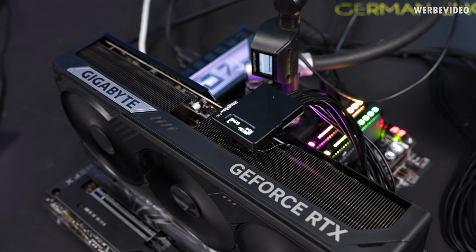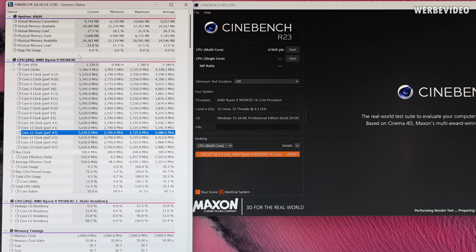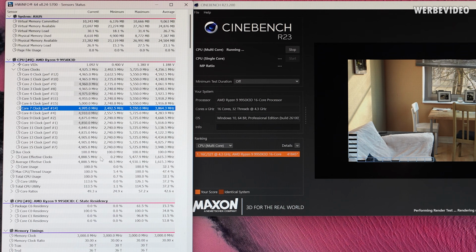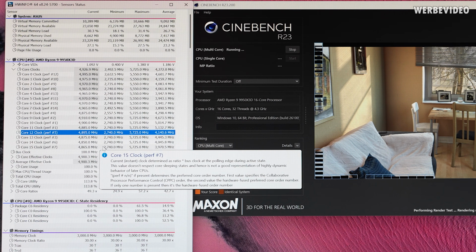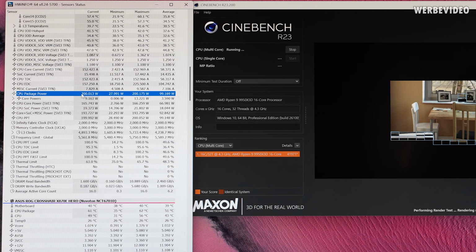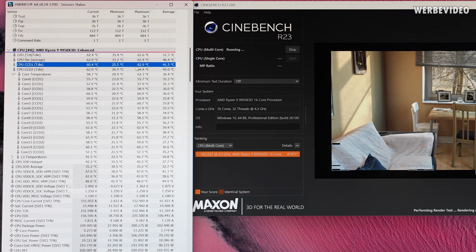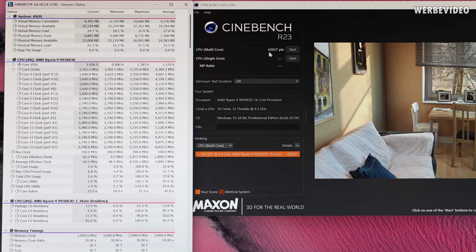With this, especially for vertical mount, this can still be quite a nice solution, especially if you want to monitor the connector temperature. First, we are looking at the stock condition using Cinebench R23 for a heavy multi-threading load. We have two types of CCDs, cores 0 to 7 and then 8 to 15, one with the 3D V-Cache, one without, and you should see something around 5 GHz under heavy multi-threading load like this scenario. The first CCD is doing about 5 GHz, slightly below, and the other one is doing about 4.9 GHz in my condition. The clock is a result of the CPU being heavily power limited, which you can see here, being limited to 200 watts under load, which is also great for the temperature. If you don't want to do direct die, if you don't want to modify your CPU, you can see even with heavy multi-threading, you're just seeing a little above 60 degrees Celsius under load. So that's definitely great for the stock condition. And this gives us about 42,000 points in R23.